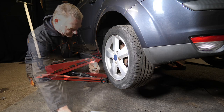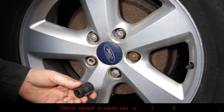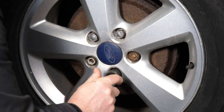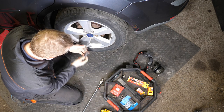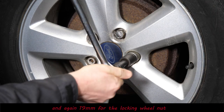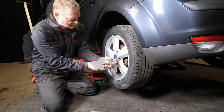Let's get started on those swollen wheel nuts. I'll briefly demonstrate that a 19 millimeter socket is what should normally be used. One that isn't swollen fits fine — so 19mm is our datum. For the locking wheel nut, it's also 19 millimeter, no problem there.